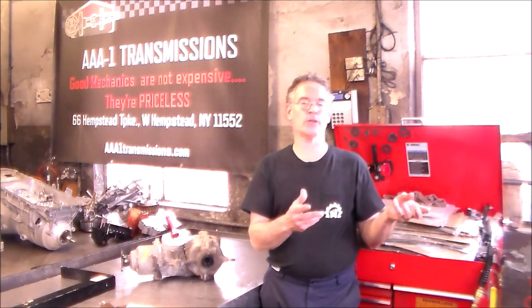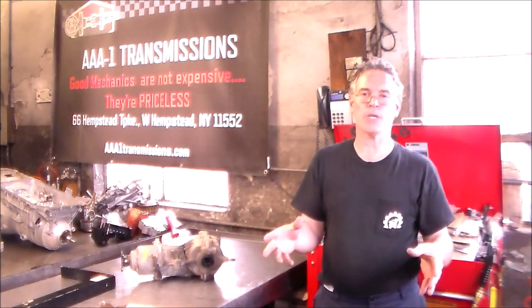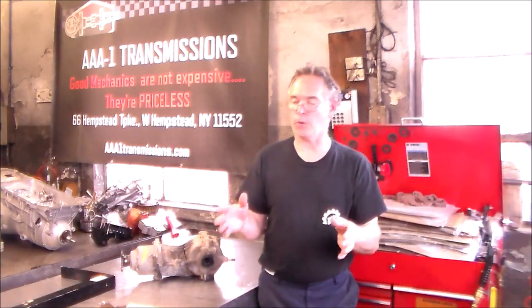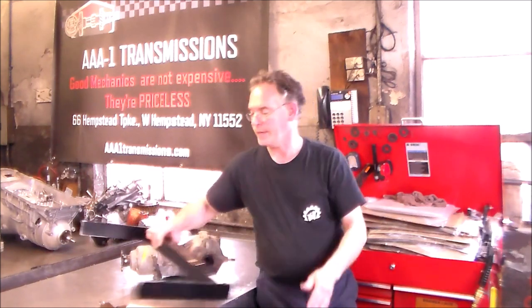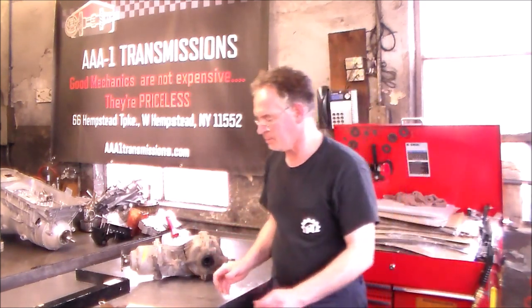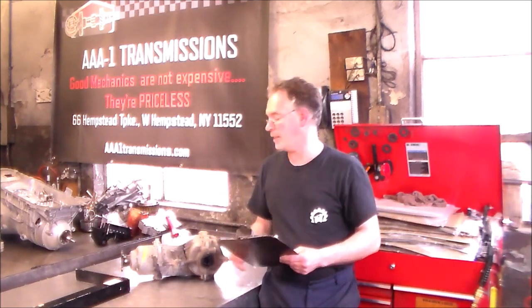The manager already ordered tires, and we had them brought over to the tire shop that we deal with. We got two brand new tires because the tires in the back looked fairly new. After the tires were on, we used this to measure it, and there's maybe about a quarter of an inch difference from front to back, which is fine, no problems. There's no way that car was leaving here without the right tires on it on a rear diff that I've got a guarantee on.